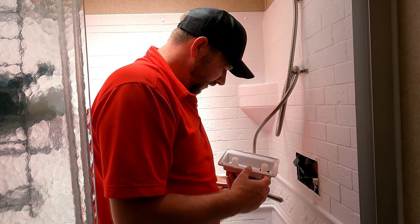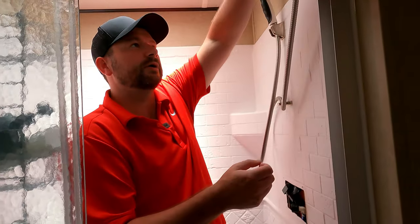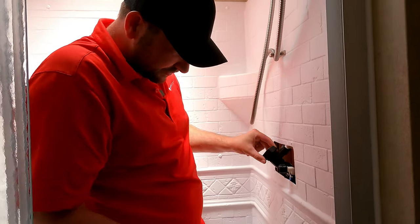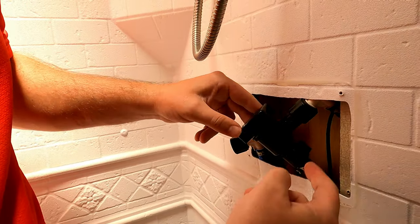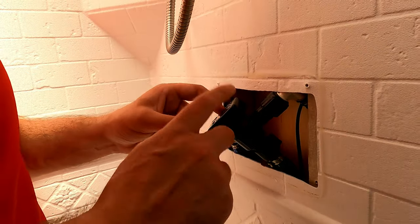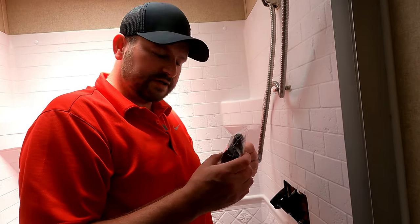So I've pulled this off. There is the blue pipe and the red pipe — obviously hot and cold. I've disconnected those from the back of the shower unit. Now I need to put that somewhere out of the way, and straight away I can see it — this is the backflow preventer for the black tank flush. There is an in and an out. I'm almost certain this is where it's leaking from. I know these have issues. Luckily I bought a new one just for this occasion.